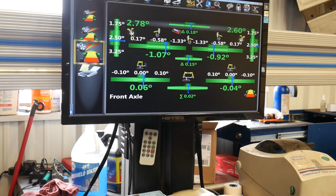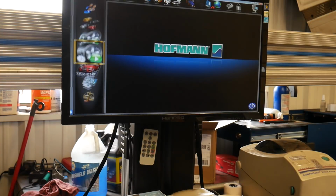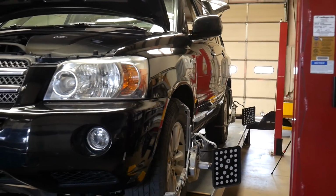But that's that. I kind of expect the other clamps to have very similar results because of how close to 0 we are. But right now we're verifying that the AC200 clamps have a good calibration file to follow. Since the 400 clamps were factory calibrated and the 200 clamps were not, now that I have the field calibration performed, we want to make sure that there's not more than a couple % discrepancy between the two clamps. So now I'm going to go back to home. I'm going to start from scratch doing the exact same procedure with the 200 clamp, and we are going to verify that we get the same results.